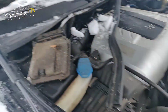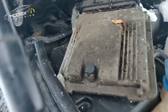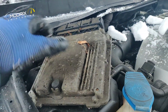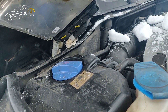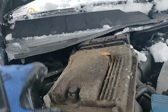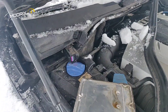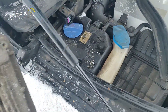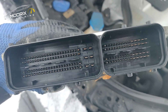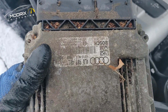It's a Bosch unit. I already pulled it out - there was none of the usual signs on it, you probably don't know what's wrong with them, but there is no communication. This looks like there's plenty of water in here, plenty of nasty stuff, so we need to get these plugs off. I unplugged the ECU. When we put on the diagnostics the other day there was no communication with the engine control unit - the car just stopped while it was driving, lost communication with the engine control.